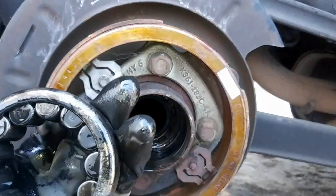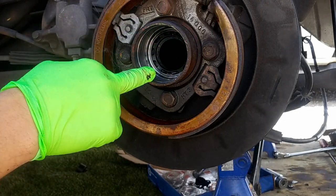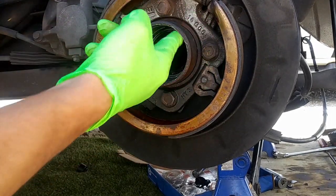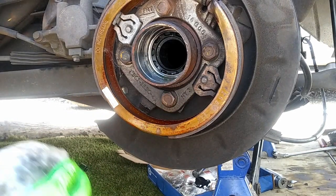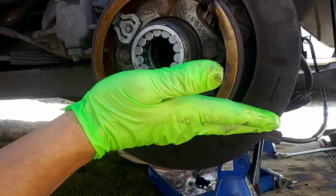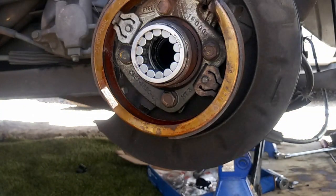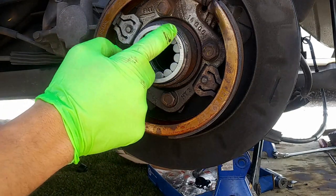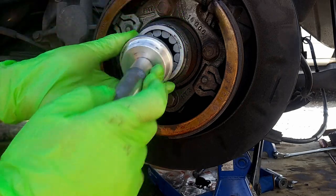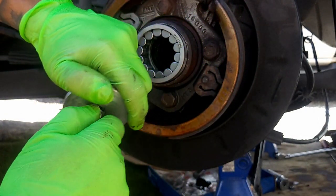Here's the bearing itself - make sure you measure it and bring this with you so you can measure the new one; you don't want to be driving back and forth. We're going to go ahead and install the shaft bearings. Before we put that in, you can either put on wheel bearing grease or some differential fluid - we'll just use the differential fluid. Set this guy in flat as possible, and the race tool we're going to be using is the 2.555. Make sure you're hitting the outer side and not the bearing rollers - if you hit those, you're going to need a new one.